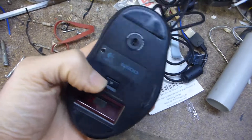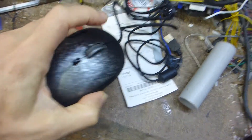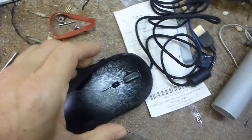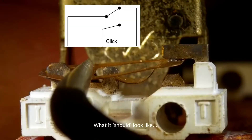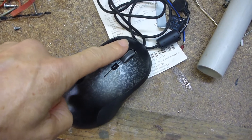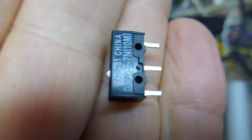Today's little project: I've got a fairly ancient Logitech G500. The reason I want to repair it is it's got the dreaded left-click problem — you left-click and you can hear that tiny little Omron 10m switch clicking away, but it's not consistent. You can click and drag and you might lose the click halfway through, so if you're moving a group of emails from one folder to the next, it might drop the click and dump them in the wrong folder. Same thing in Windows Explorer — it's a pain. So I've bought a replacement micro switch.